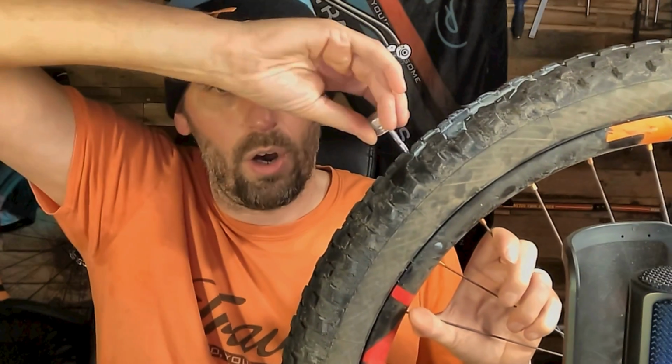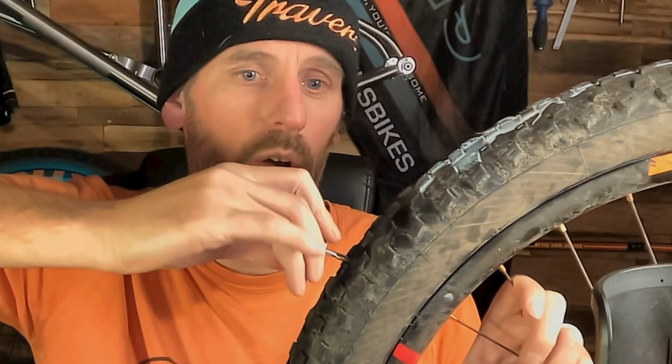So what do you do if the tyre won't seal with the sealant alone? You've got a number of options. Obviously, the most extreme is to replace the tyre, but you don't really want to get to that stage. Ideally, you have a small tool like this. There are lots of different brands, but this is the Crank Brothers one. I've mislaid the bits of rubber, but they're called tyre bungs or bits of bacon, and they're called a number of different things. You put it in there, push it in the hole, twist it, pull it out, and it will get stuck in there and fill the hole.